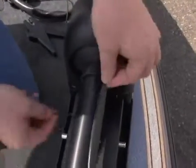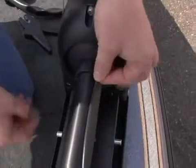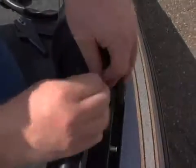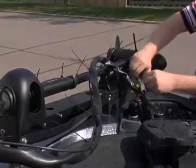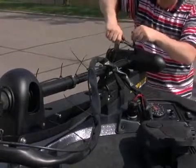Continue to run the cable up the shaft and then along the foot control cable. Space the cable ties every foot or so. Once you have secured all the cable ties, go back and clip off all the tag ends. Make sure you leave a little extra cable tie on the large puck tie so you can tighten it again later if you need to.